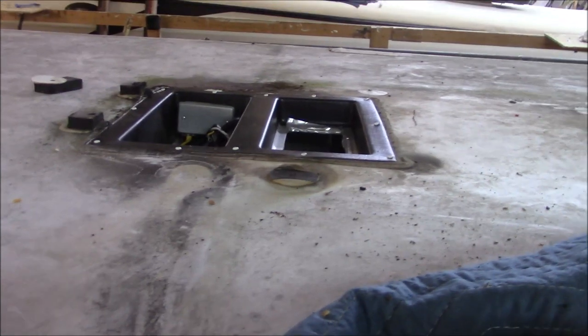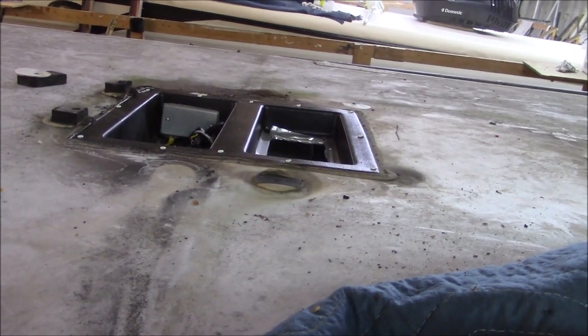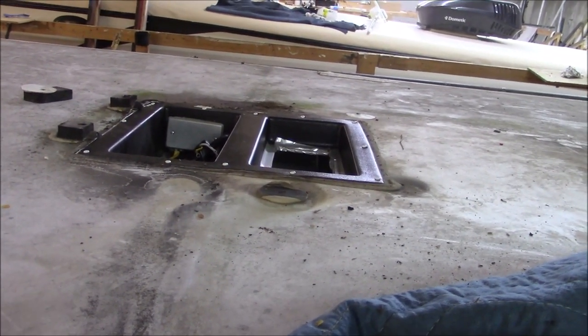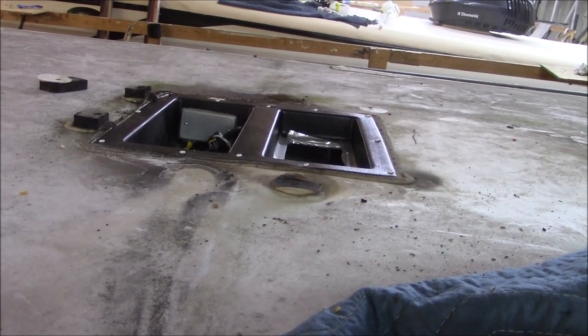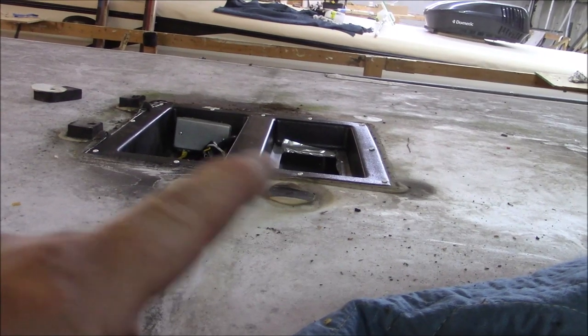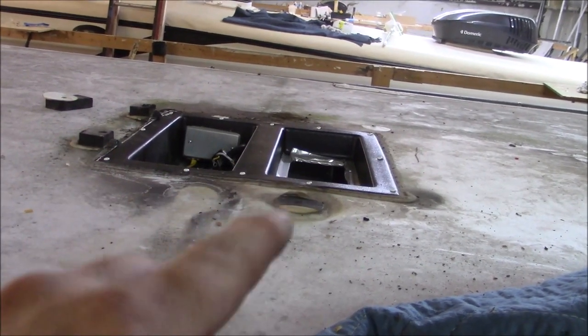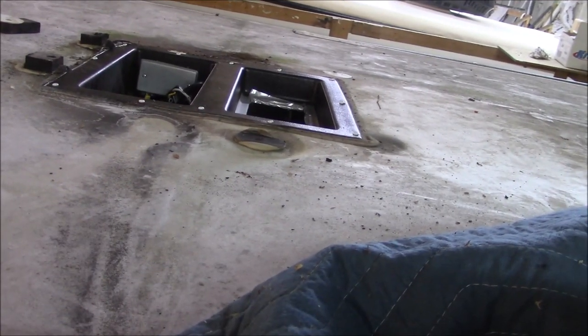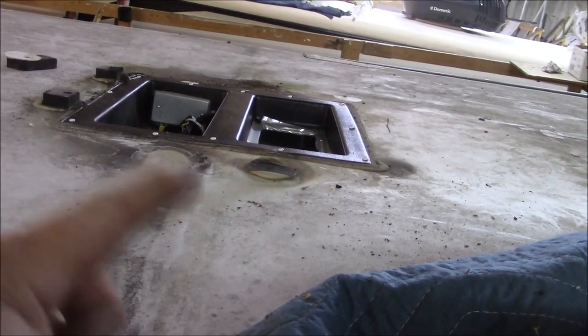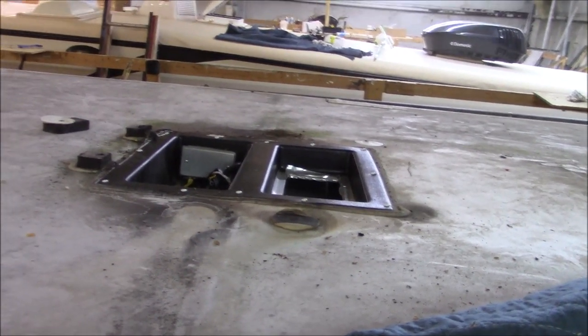We'll redesign the curbs, and when I redesign them, they have mountings up inside them after I make them. So then anybody who needs to service it down the road, they don't have to go through all this — trying to get it all out and reseal it. The more you keep driving that bolt down through there, you're just going to wallow it out. We're going to put in some plate steel where it will bolt down inside.